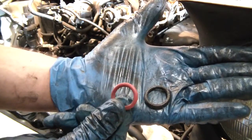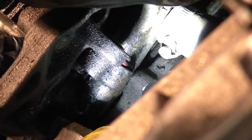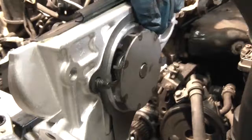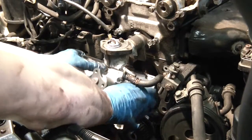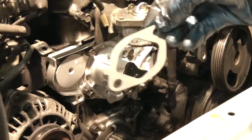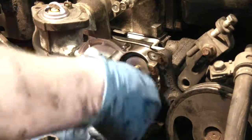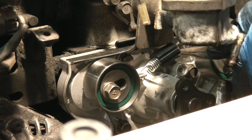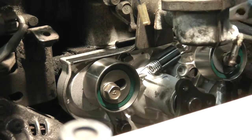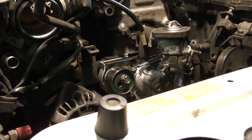Right here — you have to pull it away from this hard line in the back. I got the replacement right here. It's much easier to take apart. Take this power steering pump completely off and then you can get to the hard line in the back. There you can see the brand new o-ring on that hard line right there. So I put the gasket on the back with these two bolts holding it on the brand new water pump. Here I'm going to put the second gasket in for the water pump, and this one just goes in all the way over here. So then when you put the belt on, you unleash that tension.